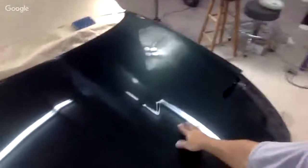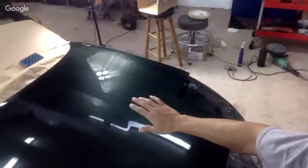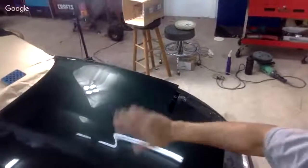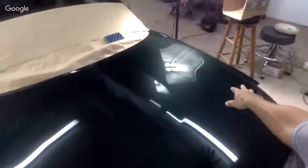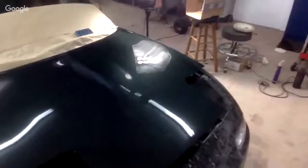Just go over what you did and just start sanding. You're going to sand the compound and wax off and everything. It doesn't matter. You're not painting it again, so you could just sand it and then rebuff it if you have to. But overall, you can see a big difference between that end and this end. We need to finish up the hood. Now I have to buff the rest of the car out because now it doesn't even look nearly as good.